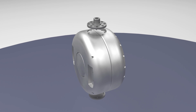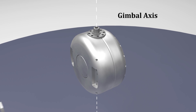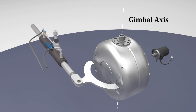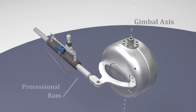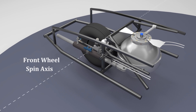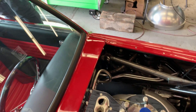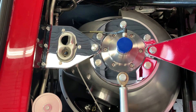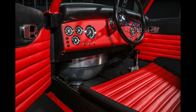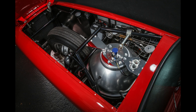At the top and bottom of the gimbal housing, two support flanges are installed. These support flanges allow the gimbal housing to pivot. The axis created by this pivot point is called the gimbal axis. Once the gimbal housing is installed in the spherical support housing, there is a narrow band within the gimbal axis — about 60 degrees total movement from left to right — where the flywheel can be controlled to make corrections in the balance of the vehicle. With the sphere assembled, the unit is mounted in the vehicle frame between the driver and front wheel.